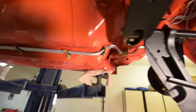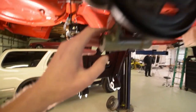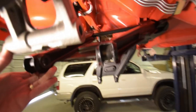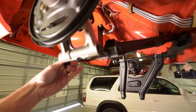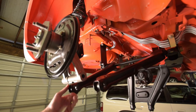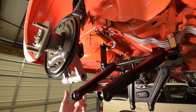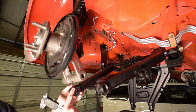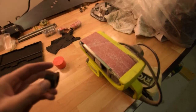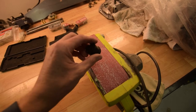Off camera we've gone and refurbished the fuel lines — they came out awesome. Now we're going to connect the transverse link to the struts. With the two bushings already placed on the insides, their thickness makes them too large and the strut won't fit. We need to measure with calipers and sand these bushings down by about one and a half millimeters — three quarters of a millimeter off each side. Using a belt sander, we'll sand down the lip on both sides to get the right thickness that will allow the strut to fit.